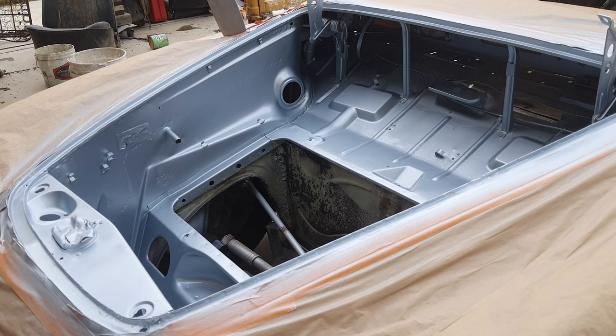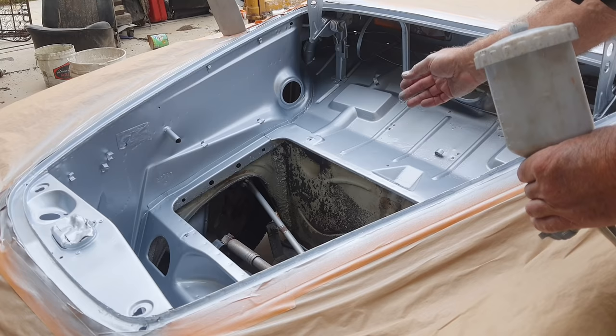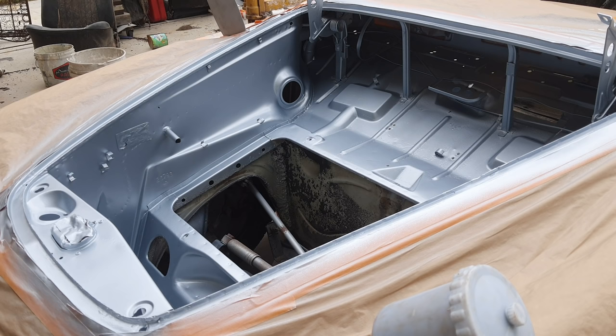if you get uneven metallics, like I think I got a little run going on right here. Yeah, I do. So I'll fix this, and I'll show you guys how to fix it. Because this is not your regular, this is a single stage urethane, a satin. Then I put automotive clear. This is a sign paint, but it's still done the same way. It's still automotive type paint. So let me get something and we'll fix this little run.